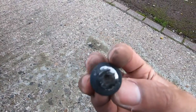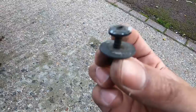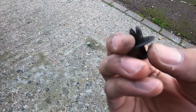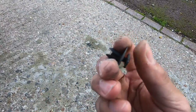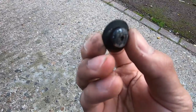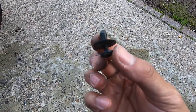I don't know if everybody will have the same fixings on their bumper and under tray as I have on mine, but these are fairly simple. Once you pull the middle part out it allows the prongs to close back up and then you can pull it all the way out. When it's fully pushed in, it keeps them spread out, hence stopping whatever it's fixing from falling off. Anyway, now that's done we've got a few more bits to remove and then we should be able to take the bumper off.